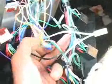Our power wire for the child reminder, we typically pull it off of this red wire from the tail marker light relay right there. That's constant 12-volt power. We typically connect the yellow wire of the child reminder to the accessory power feed to the interior light switch. In this particular bus, this happens to be a red wire going to the switch and is labeled H3.